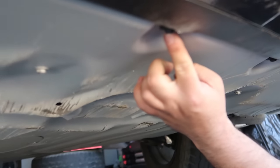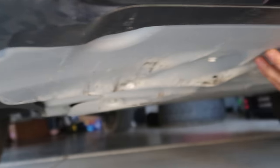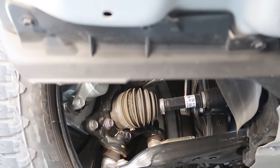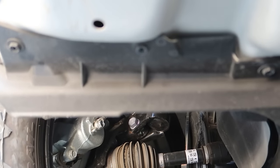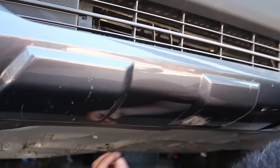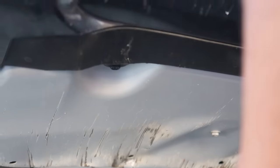Continuing with the removal of the bumper — at the bottom you're going to see six 10-millimeter bolts with Phillips heads in the middle. There are going to be eight of them in the front holding the bumper onto the skid plate. Then continuing on to the mud flaps, there are going to be another three that need to get removed as they're attached to the skid plate. One thing I wanted to show you — this RAV4 is not going to be a mall crawler. As you can see on the skid plate, it's already bashed in and it doesn't even have a thousand miles. Stay subscribed because we're going to be doing some tests with this thing.